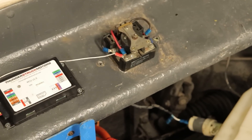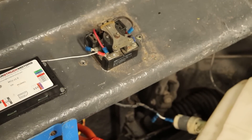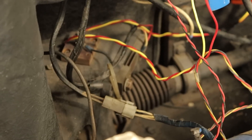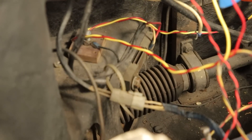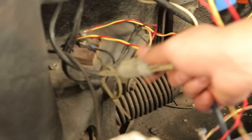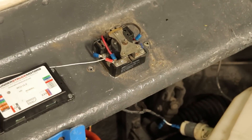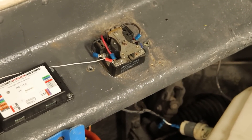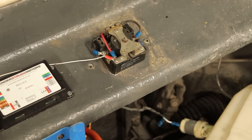I'm happy to report I've fixed the issue. I traced the wires back under the hood and crawled around in the dash, and I found this connector right here — a diagnostic cable for the motor which gives us motor temps, RPM information, and other important data. I had this unplugged, which caused the car to go into a state of non-drivability, meaning the contactor wouldn't close. But now when I turn on my power supply, you can see the contactor clicks on because the key inside the car is on. That took longer than it should have, but the contactor works now.